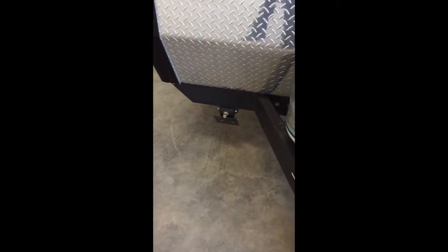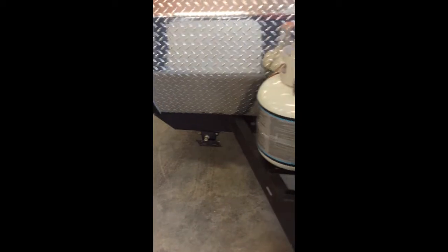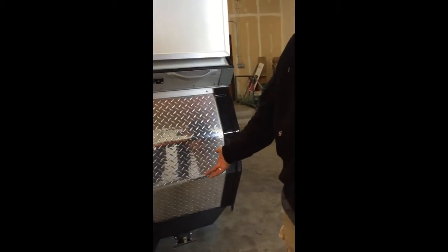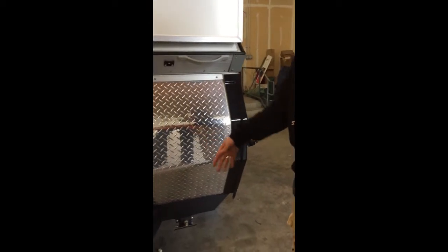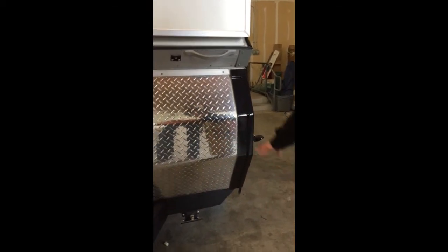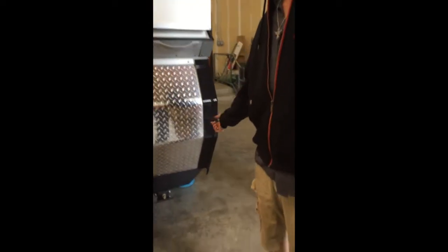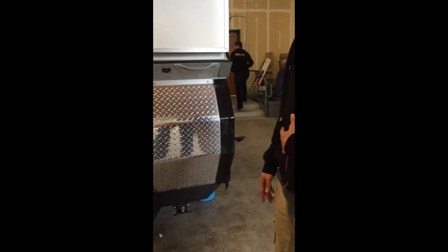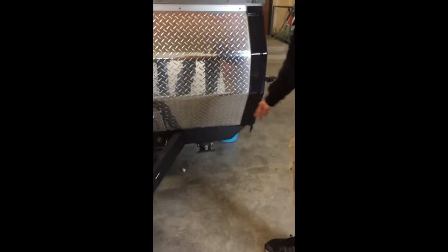On all four corners you have stabilizer jacks. Thanks for taking good care of you guys out here. Awesome. I'm taping everything you say so I don't forget. Like I said, they are just meant for stabilizing it while you're inside walking around, so it won't be moving around on you. You'll want to pull the trailer up on some blocks or something if you need to get it level, and then put those down to the ground from there. That is a 3/4 inch socket. If you put it on a drill, it makes it a lot easier.